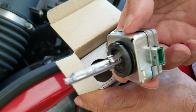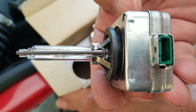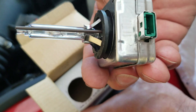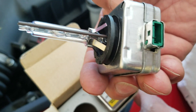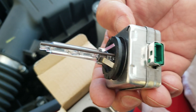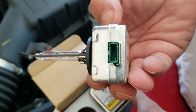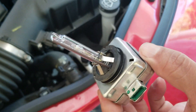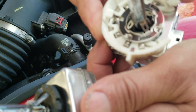You can get these bulbs in multiple color temperature ratings, and it's hard to find out what the factory rating is. My research shows it's around 4300K from the factory. The higher the K level, the bluer the light gets, but they may actually emit less light. I'm not the expert — make your own choice. I went with 5000K which is supposed to be a pure white. One thing to note: new bulbs do not come with the plastic retainer ring.